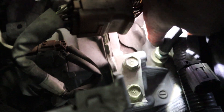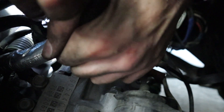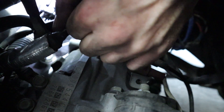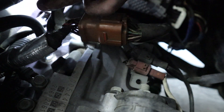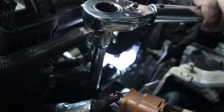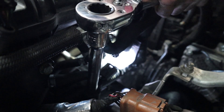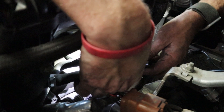We don't have an EGR that we have to worry about, so we're going to take the hose off of this right here and put in the fitting for it. Now we've got our torque wrench - we're going to set this to 15 foot pounds. I feel like that's plenty tight. Now we're going to take our 90-degree fitting and plug it into the back of our PCV. Move this back into place right here.